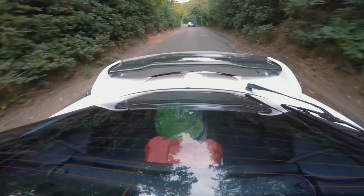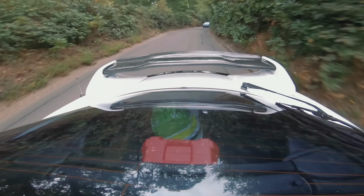Only a hiccup before the mods. And since having the mods, you said you started fitting some stuff yourself. Yeah, no issues whatsoever. This isn't the final version of this car either, is it? No, there's three steps. The first is obviously the single conversion, which is what we've got now, and then mapped. The second will be water injection, then another map. You're going to do that next year? Yes, and then the third stage is a full engine rebuild. I'm restricted at the moment because it's not built. So until it's built, then...